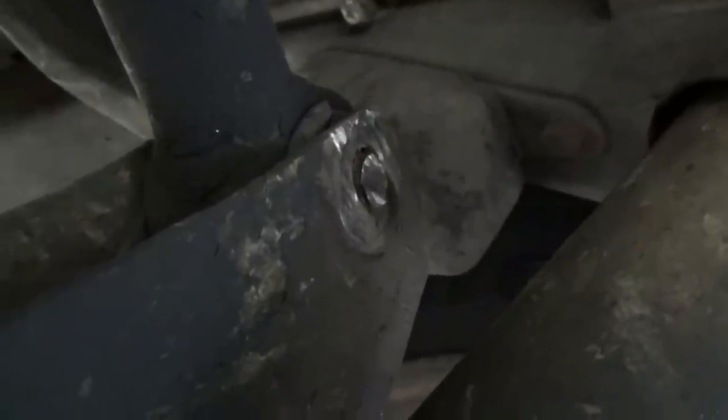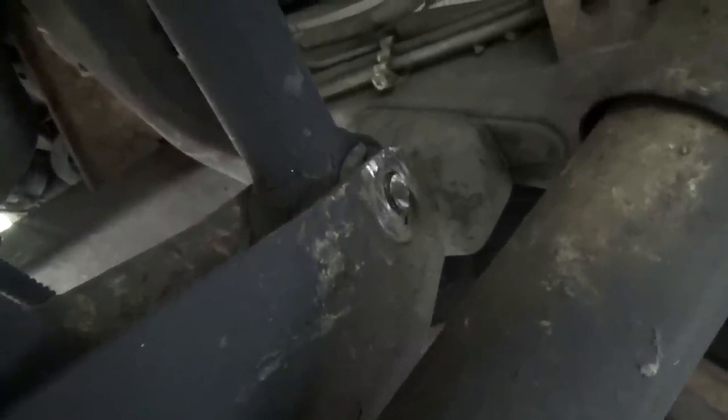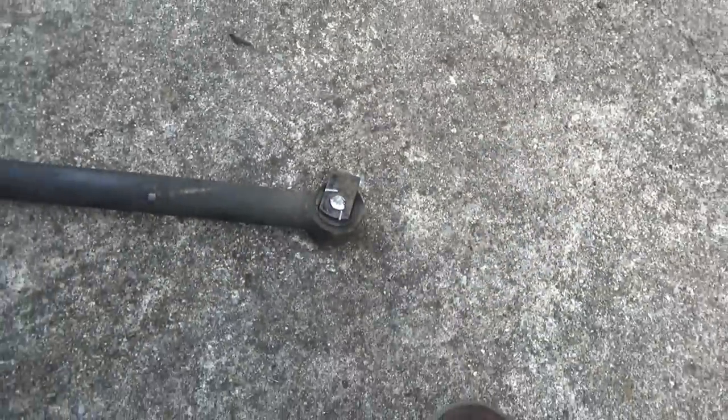So now at this point, I've got my pry bars. I'm going to see if I can spread that bracket a little wider on the rear diff right here, just if I can get it wide enough to slide those bolts out of there. Because I can grab hold of, well, somewhat. I can move it a little bit now. But I got to spread that bracket enough that the bolts sticking out come out of the bracket. So I can't do that and hold the camera. I'm going to start prying and grunting. I won, but it was a fight, I promise you that.